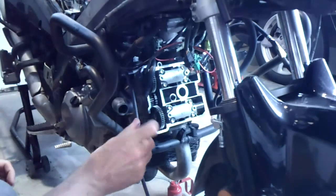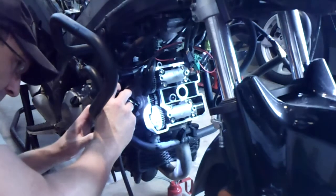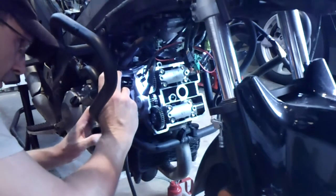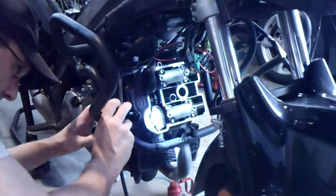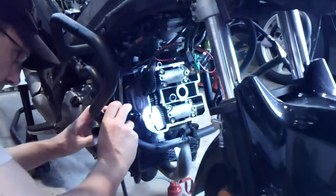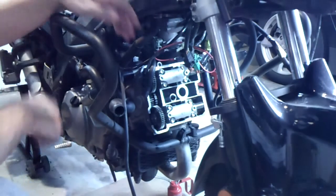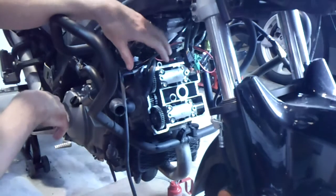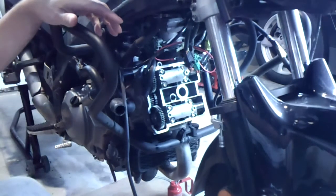And I'm going to double check that strobe. Here we go. Double check my lines. They seem good. Yeah, they're in the exact same position as the top ones. They're not exactly flush, so I must not be exactly on the FT mark, but close enough. The point is, both the intake and the exhaust match. So now you would think that we could just torque that down, and that is the next step, and button this all up. But we don't want to do that. We want to go back and remeasure that gap. So first, let me get that torque spec, and we'll get to that point.